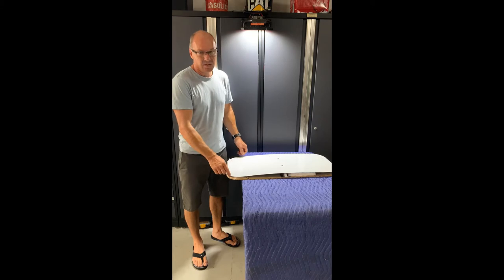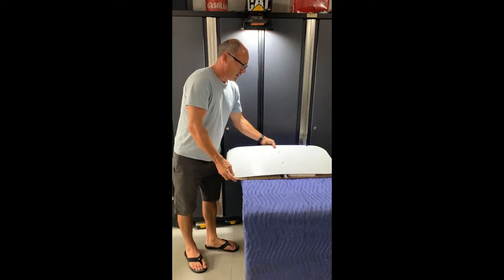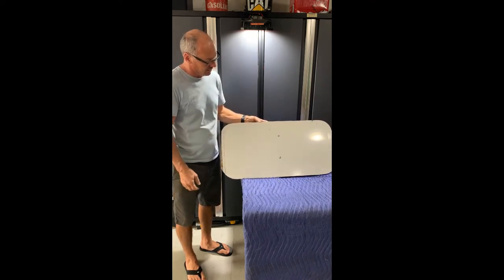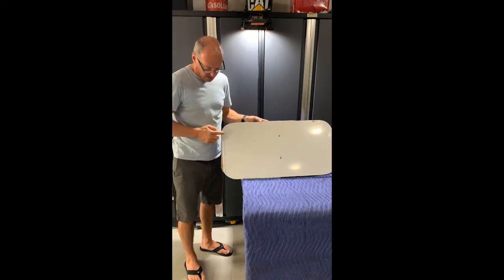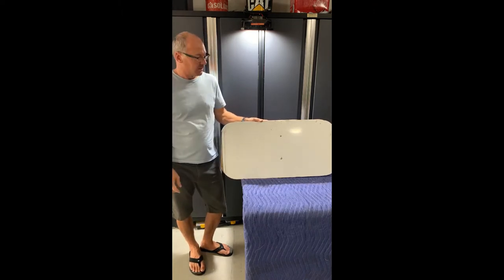To install windows on the outside of the actual cargo trailer — not into an RV door but actually cutting into the side of your cargo trailer — I'll share some specifications and things I learned and would probably do differently next time. This is the cutout I had for my window; it was a 15 by 30 window. This is the outer skin that came out of the hole I cut. You can see there are a couple of screws and this section here shows how it's bonded together — they used some sort of adhesive to join the panels on the outside of the cargo trailer.